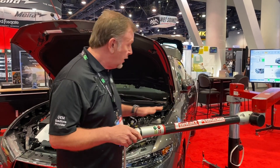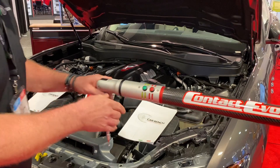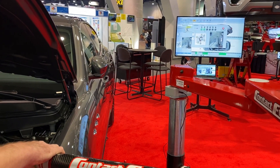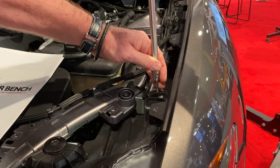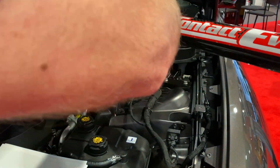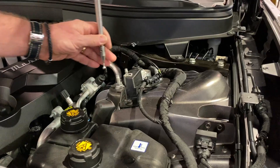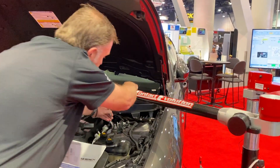We can measure the vehicle on the ground, checking all the areas within the engine bay. We can go to a point and take six measures — three around the bolt and three on the body — and you can see on the top of the suspension units we can again measure three times around the bolt and three on top. This is checking all the X, Y and Z measurements of the vehicle, which is crucial on aluminium body vehicles.